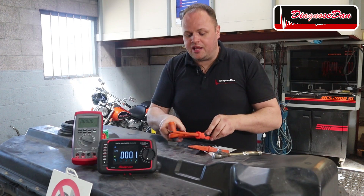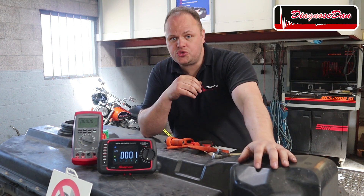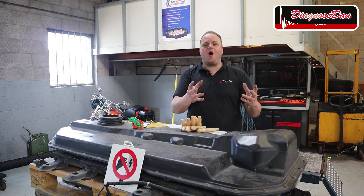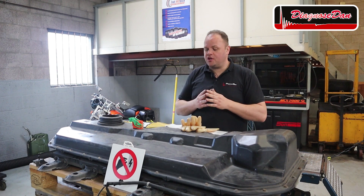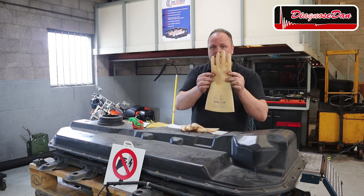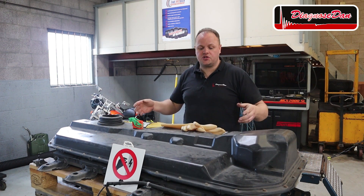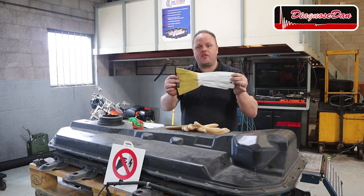Please be aware that in most countries you need to be certified to work on live high voltage, and unfortunately just watching this video on YouTube isn't enough. Now up until the point you're 100% sure there's no live high voltage at a component and you've confirmed it, you've got to wear rubber insulated gloves. These gloves are class zero, and to protect them from the automotive environment — because working on a battery like this you can easily cut them on sharp edges or poke a hole — you should wear leather gloves on top of them.